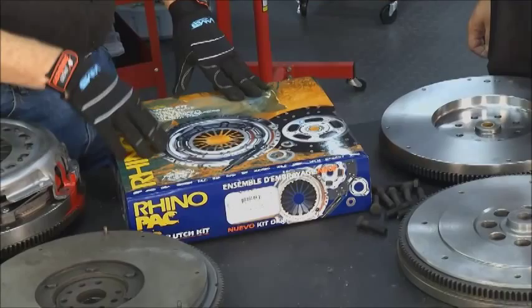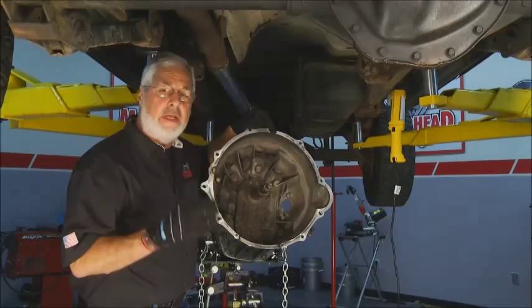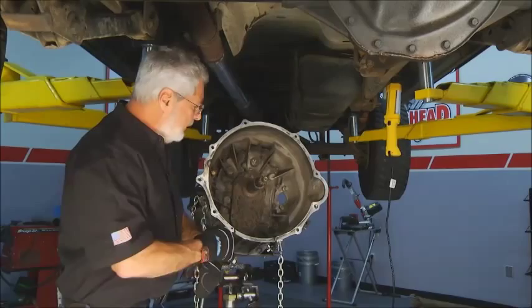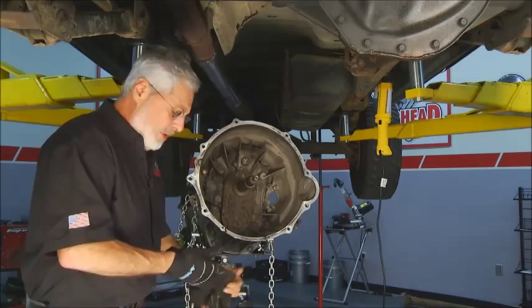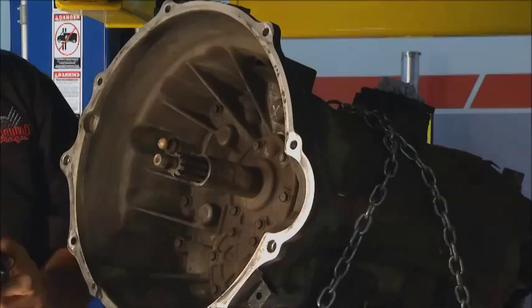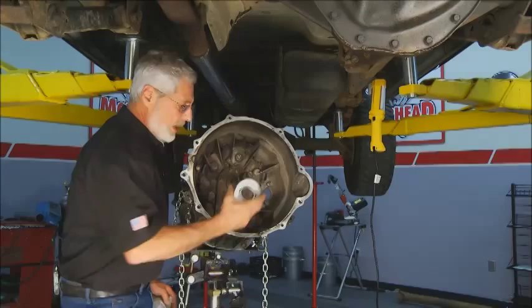One of the first things I've done here is wash the inside of the bell housing, got it nice and clean. This truck's already had a clutch put in it, and they didn't do that — there are reasons you want to. You've got the input shaft and the cover where the release bearing rides. The release bearing is bad in this truck. Make sure there are no big grooves on that cover, because if it's grooved and hangs up, you'll get poor engagement, clutch slip, and overwork the hydraulic system. We're going to put a little lube on it. Here's our new release bearing — keep it in the packet so you're ready to use it. Make sure it moves nice and easy; this one hasn't been greased yet and doesn't travel all the way to the front — it just moves this far. That's where our new release bearing is going to go.